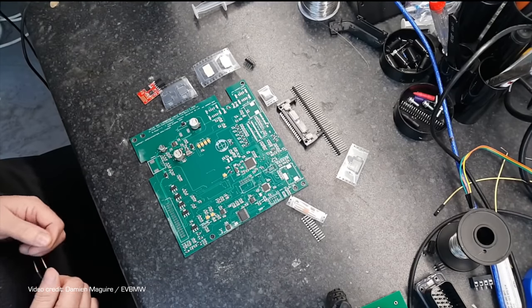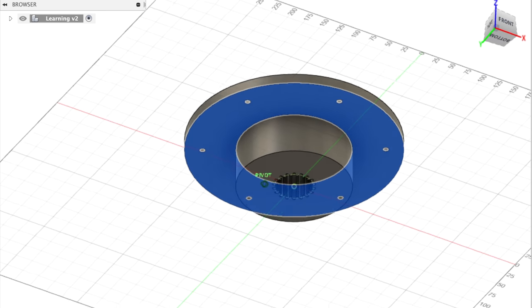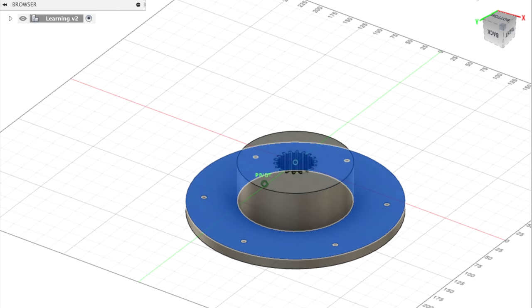So that's where we're at right now - I have a motor, I have a controller, I have an inverter, and hopefully this will work as a charger as well. I do need to order the bits to make the two of them talk, and so I'll be ordering those pretty soon - we might then have a functional powertrain. Well, sort of. I still need to order a custom backplate to mount the motor onto the gearbox, and I also need a custom mount for the flywheel onto the motor. I've done a little bit of design around that, because I think I can make that and have it 3D printed in metal - maybe. I'm a little bit concerned about 8,500 rpm and 3D printed parts, but we'll see. I'm going to talk to an engineering shop about that anyway, because I need to make sure that the flywheel mounts correctly and gets lightened - you need a lightened flywheel if you're going to put it on an electric motor, ideally. And then there's mounts for the engine bay, and we should probably also have a battery - battery also handy.